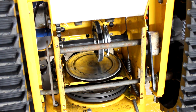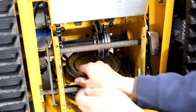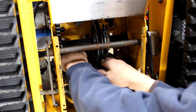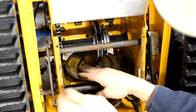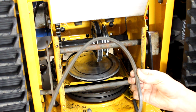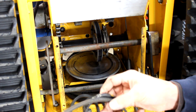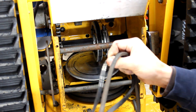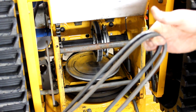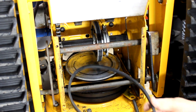After you do that, you can actually pull the drive belt and maneuver it off and under the friction wheel. Here's the old drive belt — we can see it's fairly worn. It's not looking in that bad of shape, but it's definitely good to replace it. Always want to put them side by side and make sure it is the right one. And you can see it definitely is the right one and has stretched, so we're definitely going to benefit from replacing this.